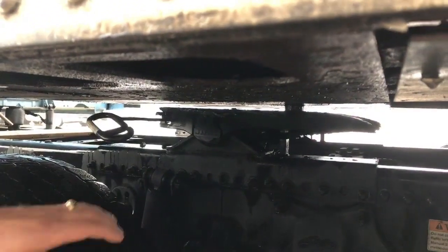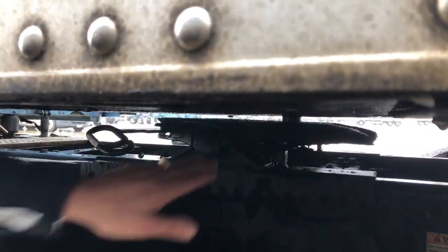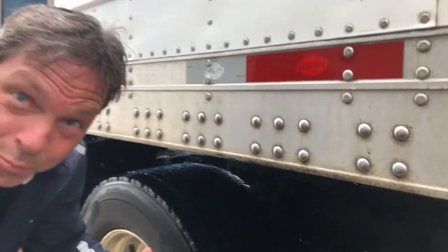If that was a little bit lower, these jaws could actually grab around the underside of that kingpin, but won't actually completely lock. Then what will happen is the kingpin will actually balance on top of the fifth wheel into little grooves. Then you'll drive off thinking you've got a good hook, only to get up 20-30 miles up the road and lose the trailer.